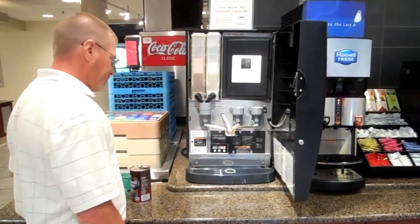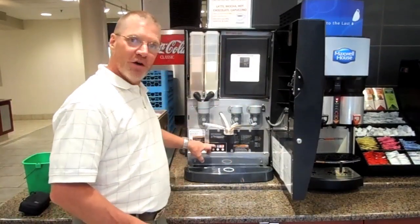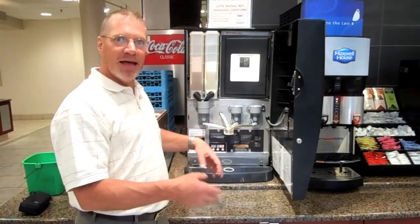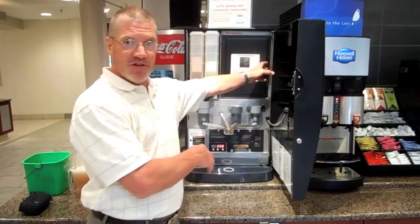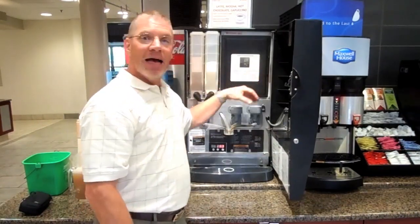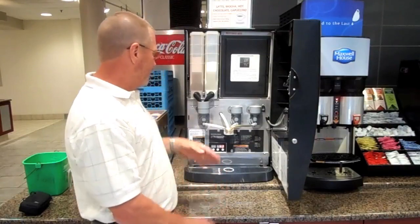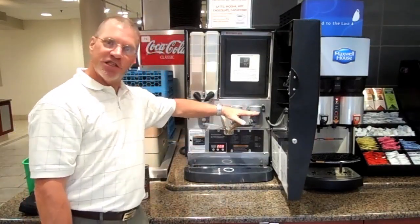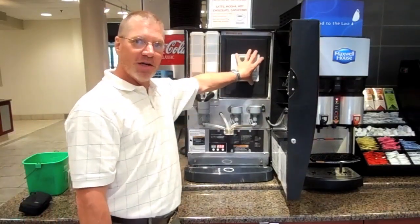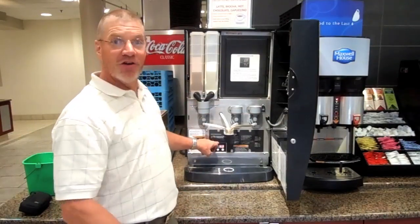Always remember to put it back on normal, and now it's ready to go. Quick review: you see all the lights blinking, the machine is telling you something is wrong. Always look at this window first — if it just needs to be rinsed, it'll say rinse. It may have an E9 or E10, which usually tells you there's something wrong with the machine. If there's no message, check your can — one of them is more than likely empty. To make the lights stop blinking, unplug it and plug it back in — that resets the machine. Rinse daily; prime the pump at least twice a week.